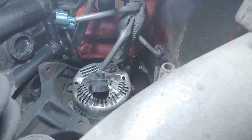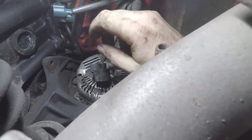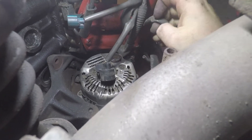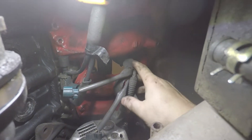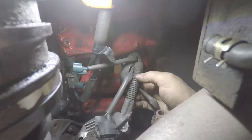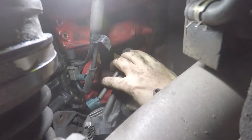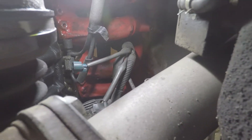It's going to be a bit hard to see, as they all are. The alternator plug and the top post need to be disconnected. This little blue connector needs to be undone, and this little red connector needs to be undone as well. There's also a bracket at the top of the intake manifold that needs to come off — it's all because this wiring harness goes through the middle of the manifold. So all those little connectors have to be taken off before I can remove the intake manifold.